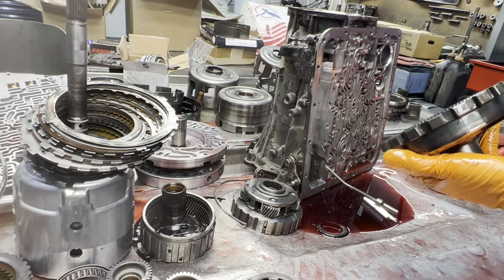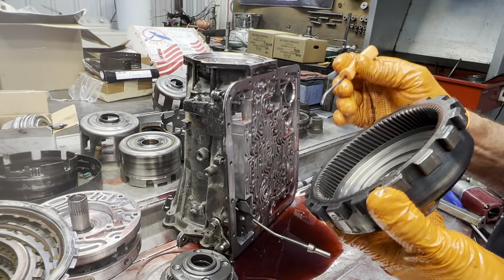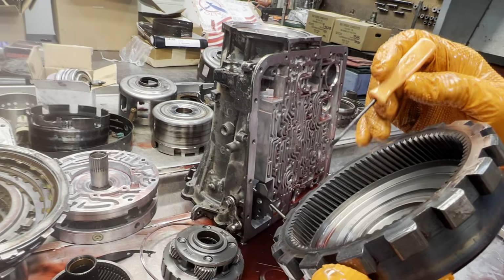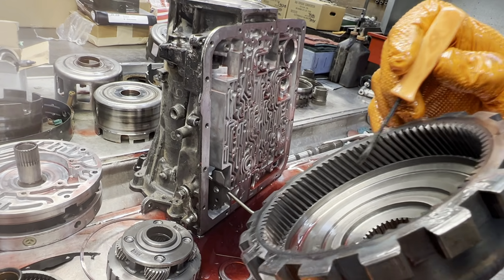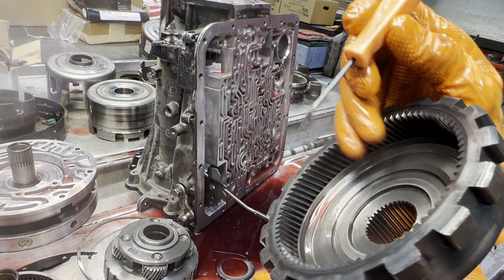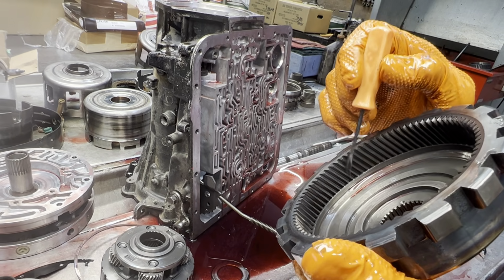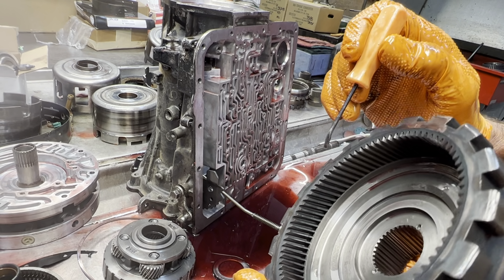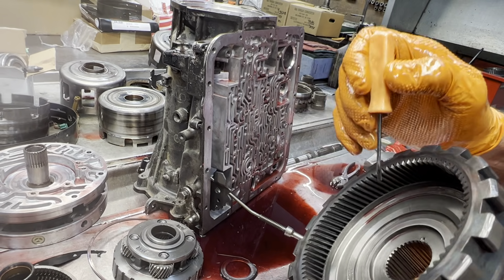Ring gears. These little jewels here are getting hard to come by. If you notice, this ring gear is worn plumb out. Can you see that, Teresa? It's kind of hard to tell from here all the way out. I see. And that's what happens. They'll start wearing in the middle and wear towards the outer down here. Wow. Yeah. Not on this side, only on the drive side.